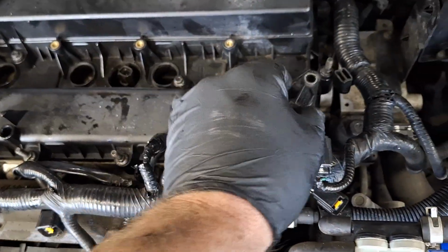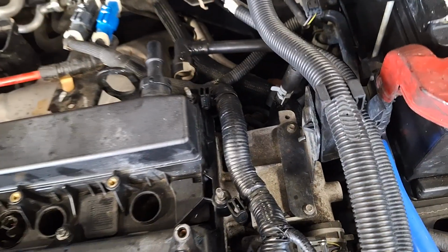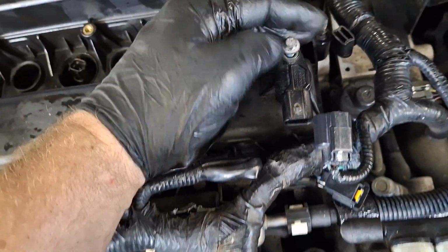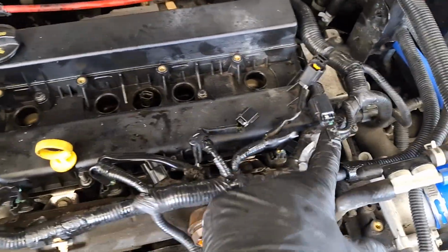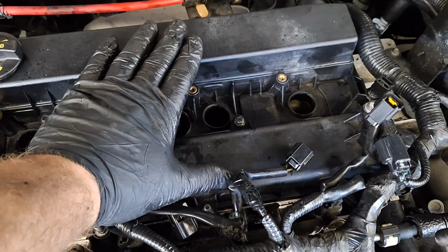I'm going to go ahead and insert the cam sensor. There's a little seal. Make sure it's got some lubricant on it. There we go. Get that bolt in there. It was the one with the Loctite on it from the factory. Snug it down. Got the harness retainers pushed back on, everything connected back up. So let's go ahead and get the spark plugs out.